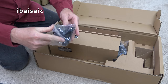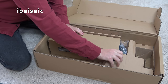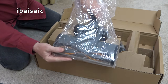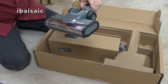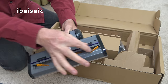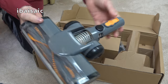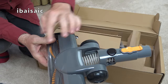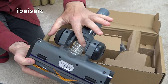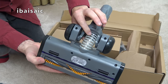This is the mains charger — being a UK version it's obviously got a UK plug on it. Here we have the floor head which is designed for carpets and hard floors because you can turn off the brush roller. It's fairly narrow with quite stiff brushes and a very narrow opening, so I'd be wary of this blocking up. I'm also a bit wary of this flexible tube that connects the floor head to the tube on the machine — I've seen other vacuum cleaners that use a tube like this and this style is prone to split.